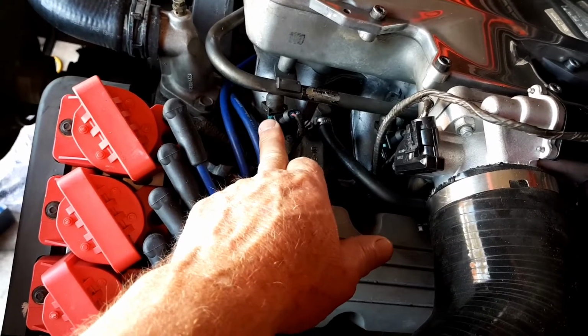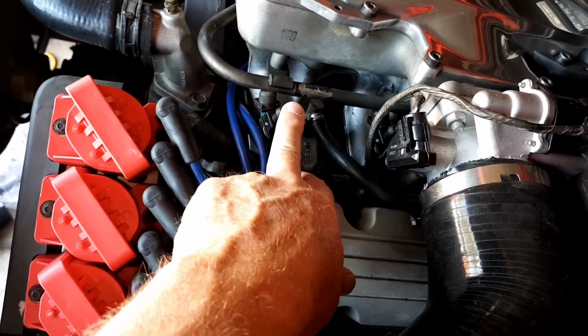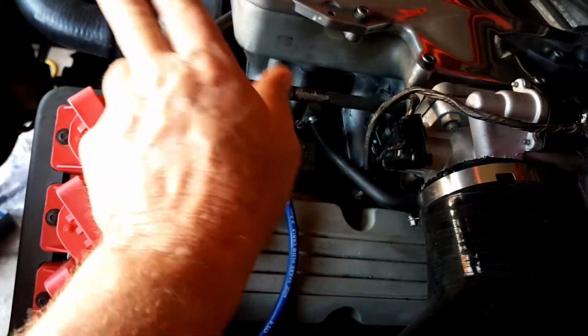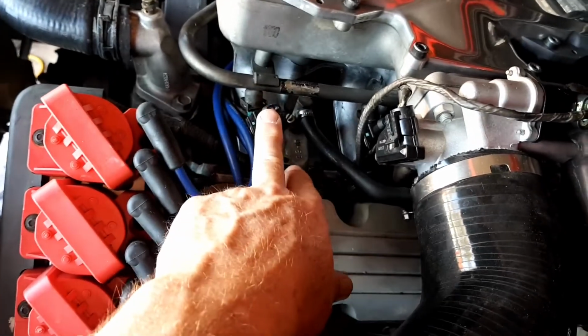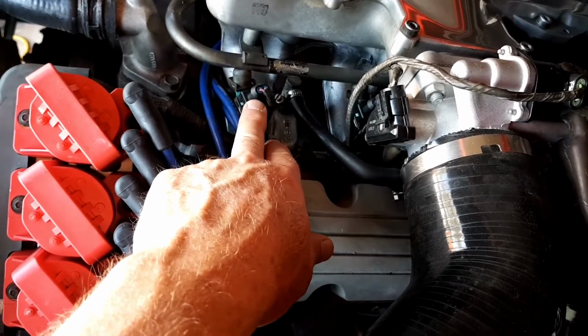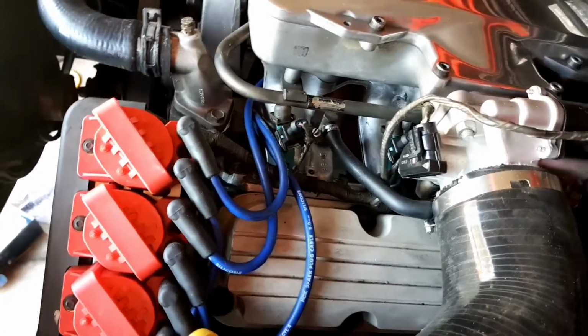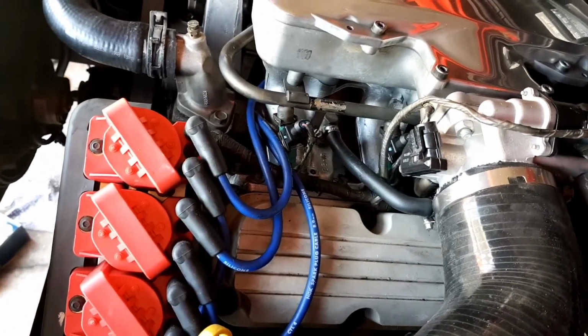So first I had the coolant problem and then I had fuel pissing out. Or actually vice versa. The fuel problem was first, because what I do is I turn the ignition on, build up fuel pressure, and this was spraying out everywhere. Luckily I got spare injectors with seals on them, so I just had to grab one off one of my spare injectors and put it on, so she's all good.